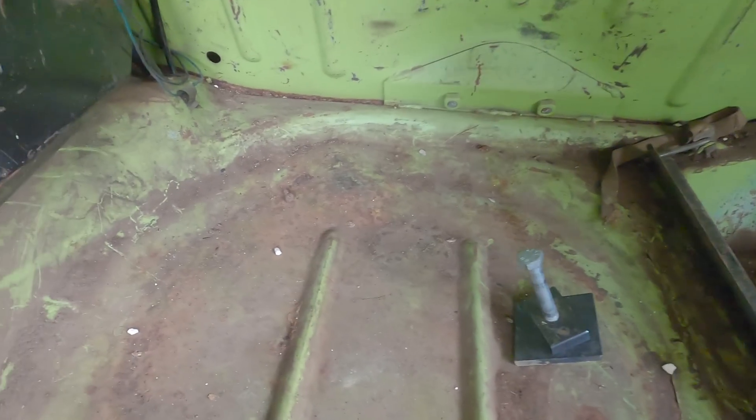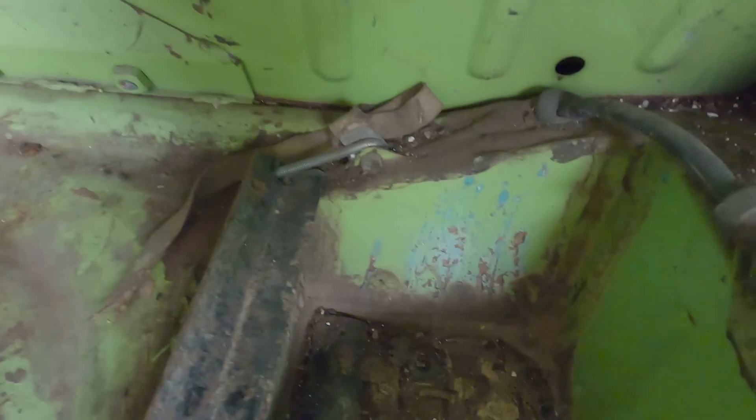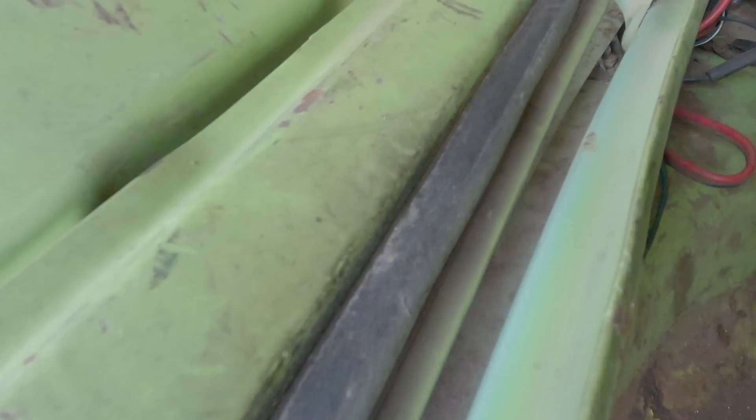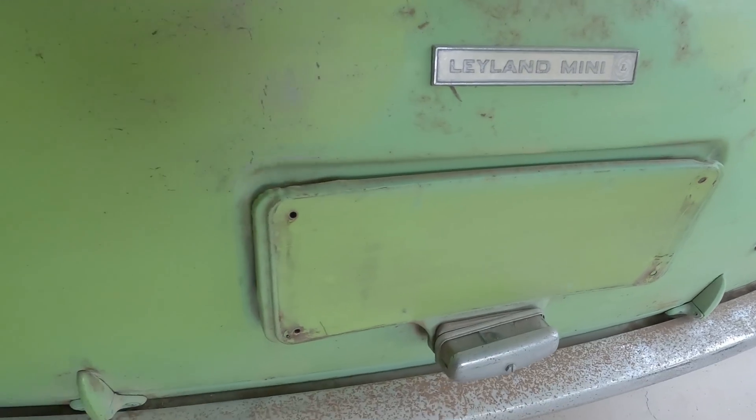All the floor pans were really good, which was one thing that I really needed to be right. You can see there where the spare tire goes, and the battery area — they're nearly always rusted out — that's still got a majority of its original paint on there. You can see there's no rust in the tailgate. Common areas to rust are along the seam and along the sills, and there's nothing in that at all. Even along the bottom there's no filler in that, so that is really going in my favour.